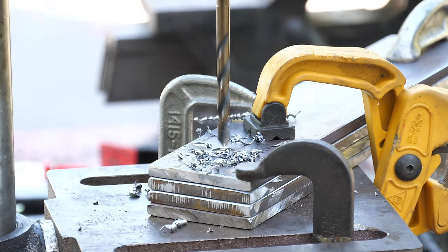If I drill this hole out just a tiny bit larger, I can get a 3/8 inch bolt up in there and just put a nut on that, so I'm basically installing a stud. That'll be way stronger than the sheet metal screws, and we can get a lock nut on there so it will not fall off, and we don't have to tighten it so much it crushes that insulator.